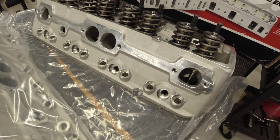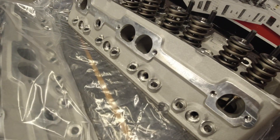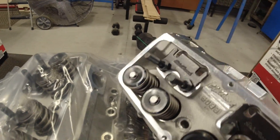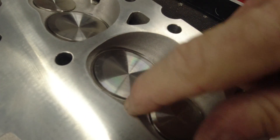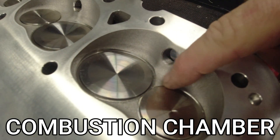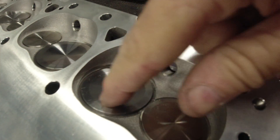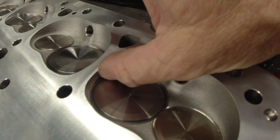This is just a stock motor — it's not high performance. It's not going to be driven like a maniac. I'm just going to drive it as a nice, fuel-economical driver. So it's not going to be punished or beat to death. I just hope that if they don't leak, they're close enough that they won't break over time. Because if you're off 8 to 10 thousandths, every time that valve closes it's shoving over one way or the other — flexing that valve stem, putting pressure on the valve guide — and something's got to give eventually. I'm hoping I don't have that issue.